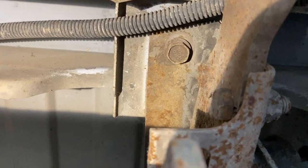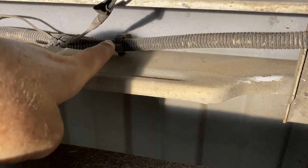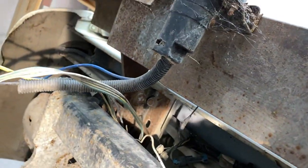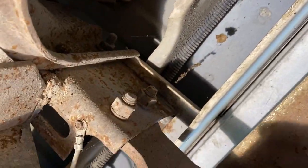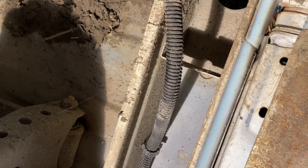While we're under here, a couple other things to disconnect: the wiring harness to your tail lights attaches to the bed, so you'll want to pop that off. There are several of those clips. Also disconnect your tail lights — pull them out and disconnect the connector; the wiring harness will drop out. If you've got a hitch, you'll have the hitch wiring harness too. It's grounded to the frame, which is fine as long as the bumper stays in place. Just make sure nothing is grounded to the body. This harness will stay with the frame.